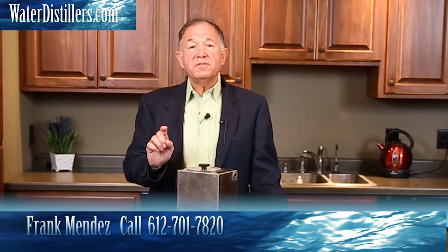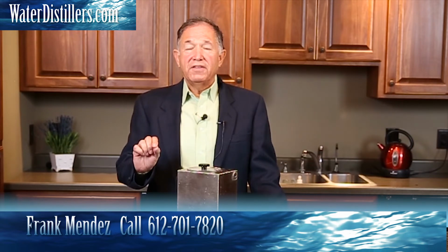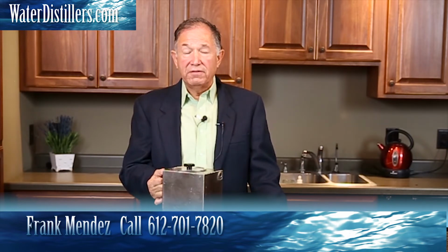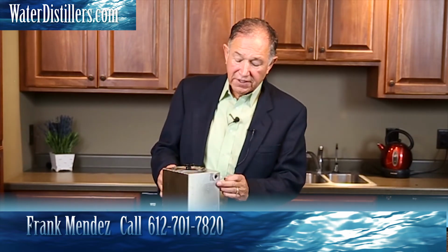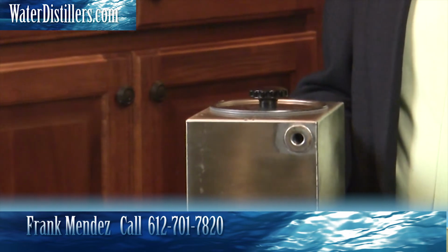But first of all, always make sure that if you see water or moisture coming out, you key in on that so that you can maintain your water distiller. These will last for years and for generations. However, you might have a real simple maintenance thing to do, and that's changing this O-ring, which you cannot see. It's a boiling chamber O-ring.